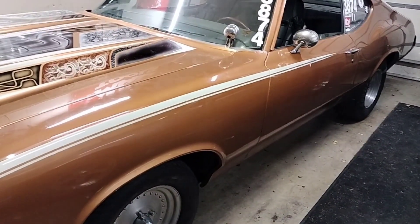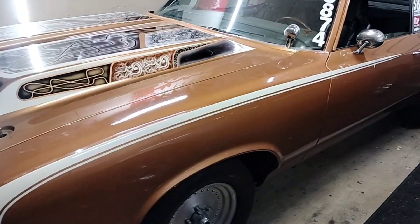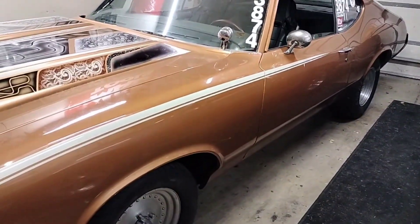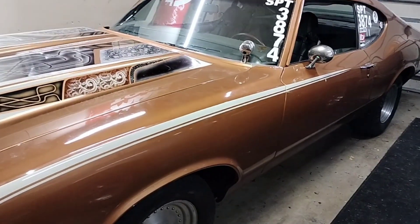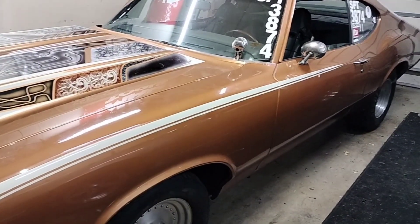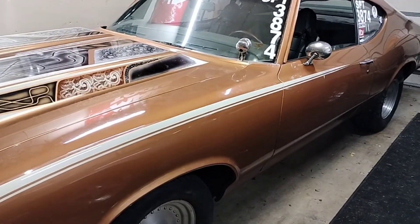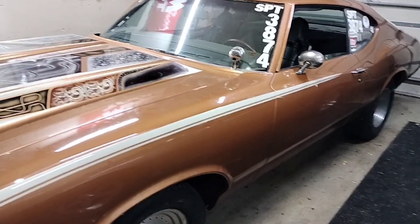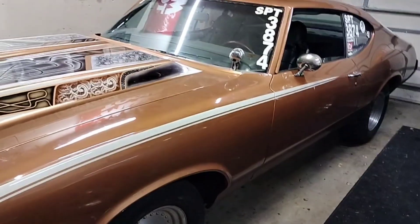I'm planning for a Saturday test day. Since the carburetor is pretty much set up — big thank you to Mylon for helping me square it away — I'm just going to put the extensions on and take the exhaust off altogether. Last weekend at our home track the car ran an 11.63 at 115, but the 60-foot is still down. We're going to lock the timing down at 34 degrees, bump it up to 36, and run it with the bias plies. We're down about a tenth and a half on the 60-foot, and once we get that squared away this car should go into the 11.30s.